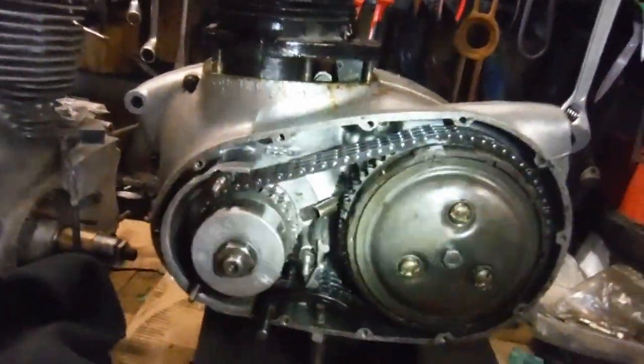So I'm going to have to lift the barrels again — perhaps not all the way off. I'll try and keep the pistons in if I can, because it was a hell of a fight. I'll cover everything up that needs covering and very carefully use one of my die grinders to try and grind a little off the edge of that tappet housing, and then perhaps the cylinder barrels might just fit.